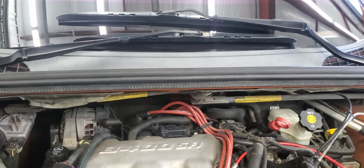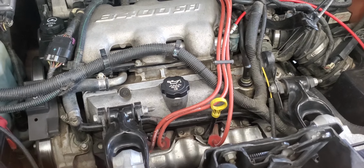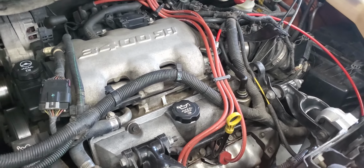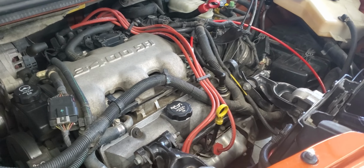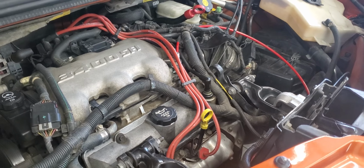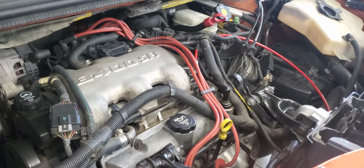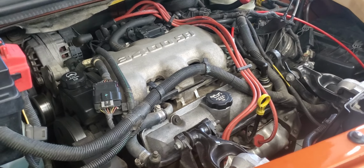It kind of steam cleans the combustion chamber, so you have very little carbon buildup, and it gives you a much lower intake air temperature. And if you've driven a car on a cool summer evening and it just feels lighter weight, more responsive than during the daytime when it's hotter, that's what the water meth kind of gives you all the time.